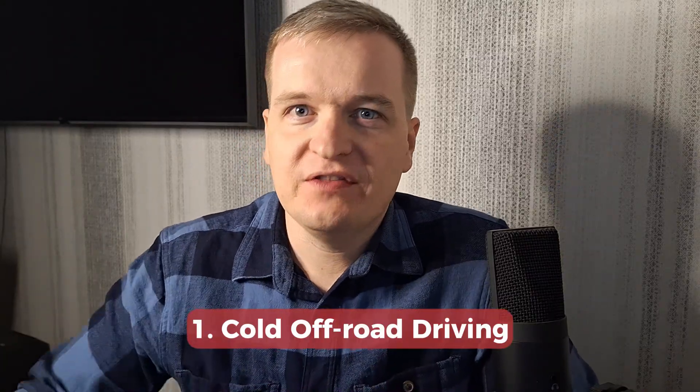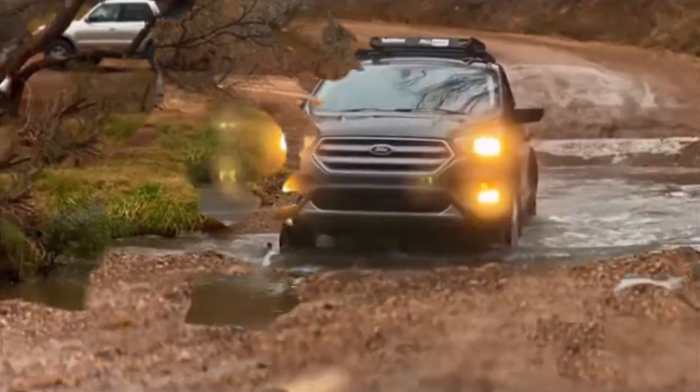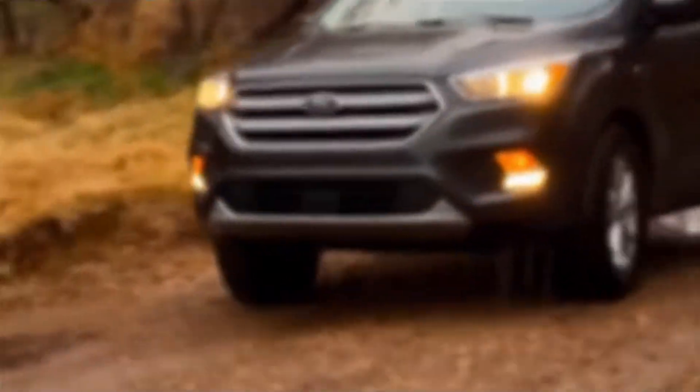But in the real world, this error message pops up because of a lot of different reasons. First of all, it can happen when you're driving off-road when the vehicle is still cold. When the fluids are cold, the differential and the transmission are not working at their full potential, and sometimes they can cause this type of error message because cold fluid causes anomalies and slippage in the differential. So you need to warm up your vehicle before you go off-roading, before you start driving on a muddy hill and loading your all-wheel drive system.